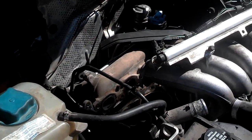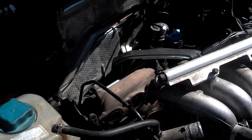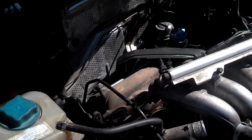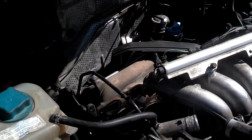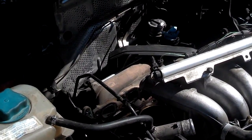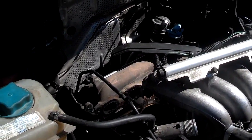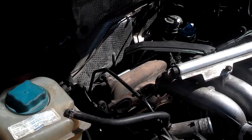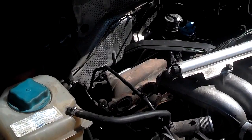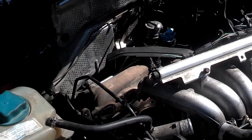I realized that the timing belt has been changed by looking at the sticker. I can't figure out if it's a 2009 or a 2004, but the car had about 48,000 miles. The only reason I think a timing belt would have been done at that time is if somebody did it because it was seven years old, which would make sense for an 04 date, or they had a water pump leaking. At any rate, I'm definitely going to do the water pump and check these rollers to see if they're serviceable, and I'm going to service it as if I would give the car to my daughter or keep it myself.